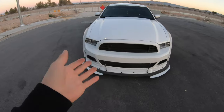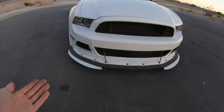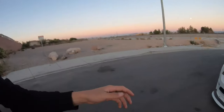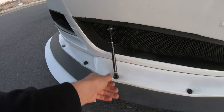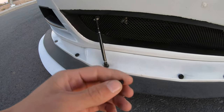These pieces up close show imperfections - they're a bit chipped up - but from a distance they look fine. I originally added them for looks and kept them because I'm not a big fan of the rods. The main reason I added them is to actually hold the full front splitter up, because the ABS plastic is heavy enough to cause the front lip to sag. And just as I was explaining that, a piece fell right off - I can't get through a video without something falling apart on this car.